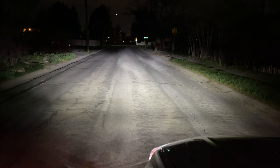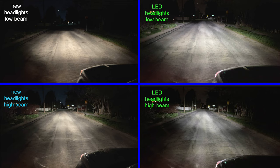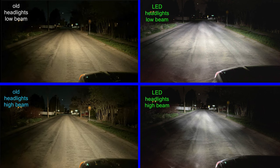Time to test them out on the road. Walking up to the car, the headlights look very bright. The low beam and high beam light up the road well and seem brighter than before. On the left, we have the new headlights with regular incandescent bulbs. The LED low beam got much brighter, it's more wide, and shines farther down the road — I can see the grass now, but the speed limit sign is still dark. The high beam pattern is almost exactly the same between incandescent and LED, but it's a bit brighter and more of a white color. At a glance, you would say the LEDs are better — they do emit more light and it partially makes up for the beam pattern being much worse in the cheap headlights. The low beam with LED looks great, but the headlights fall short with the high beams. The beam pattern in the lower right picture is just terrible — yes, it's a bit brighter at the end of the beam, but you have way more blind spots to the side of the car. I recommend buying the LEDs, but I don't recommend cheap aftermarket headlights.